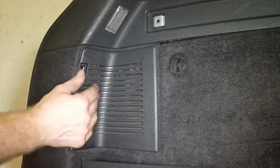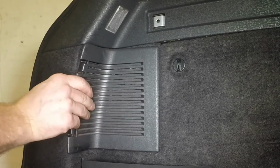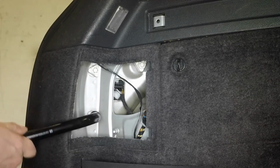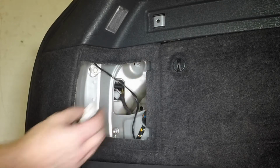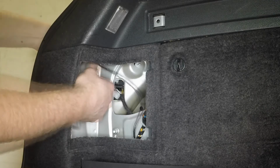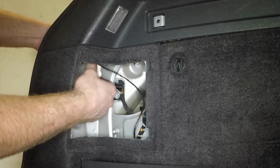Open the tailgate, release the clips and remove the access cover from the side trim panel. Using the tool provided in the vehicle toolkit, slacken and remove the 3 rear light retaining nuts. Hold the light cluster in place as the last nut is removed.